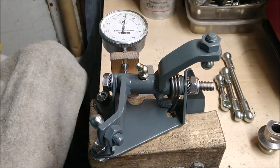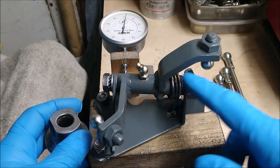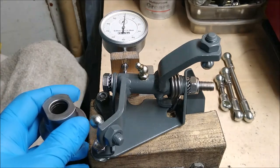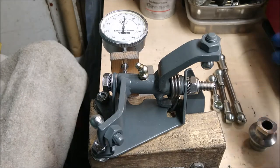It's a very good improvement — makes a big difference. If you're looking at the linkage as a whole, the collar goes here — very often very badly worn — through the relay and off to the base of the gear lever over there. The base of the gear lever and the collar usually make the most difference, but this relay is still an integral part of the system and benefits from being changed together with new linkage rods over there.